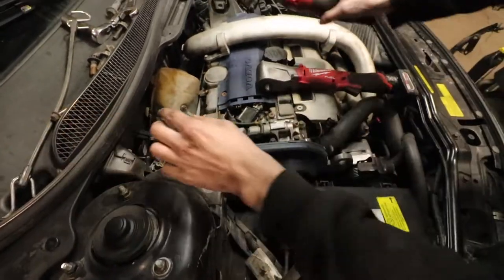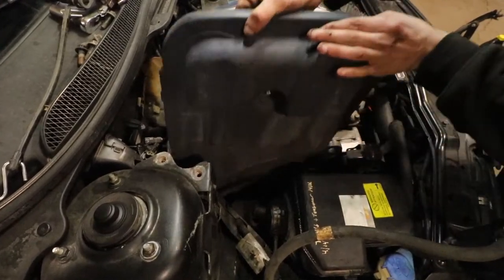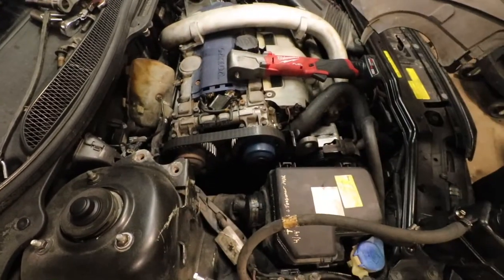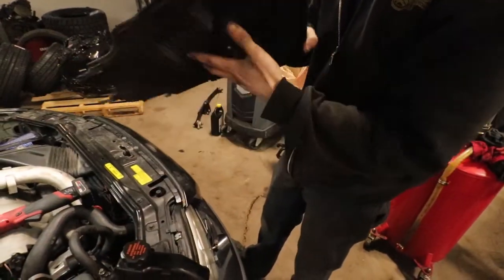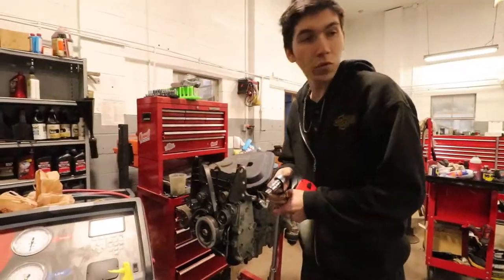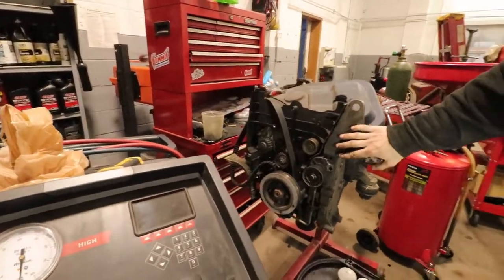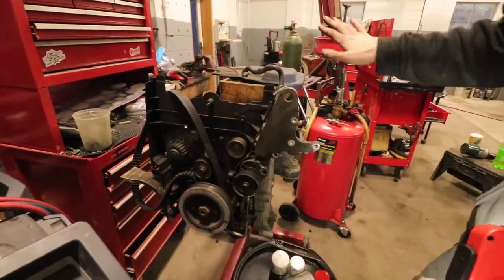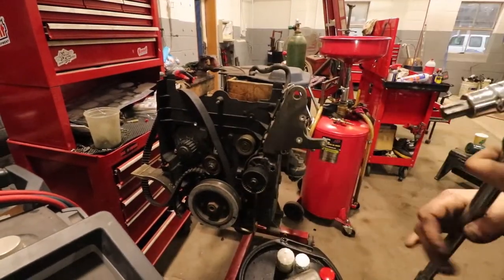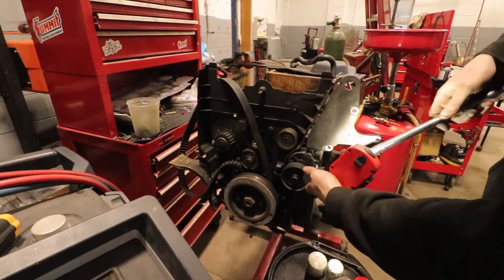A singular 10mm, and this should just lift up and out — there's your timing belt cover. Our specific belt is blue; other ones are black. For the next couple steps we're going to show you on this spare engine because it's easier to see. It has a cracked sleeve so it's just a parts engine. This is the serpentine belt tensioner and it's a T60.